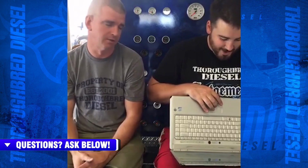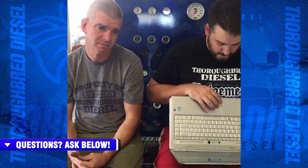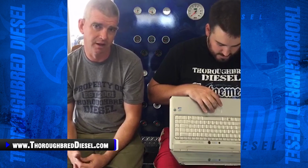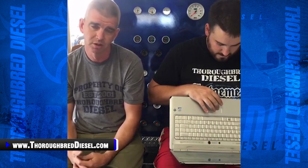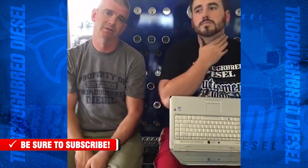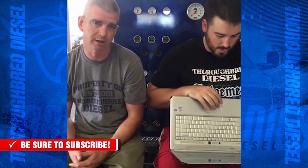Code 0373, running on about 4 cylinders when it rained. Now more frequent, but it clears up and may run 100 miles before it does it. I would lean towards the injector driver module on that. Again, that's another component of the truck that is known to have water intrusion. Check your IDM out. They've got a little chintzy rubber gasket on the back of it to let water out, but a lot of times what it does winds up letting water in. So if that's only happening when it's raining, I would probably lean towards the IDM.